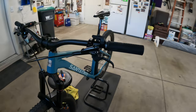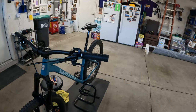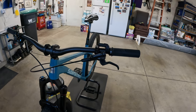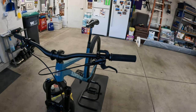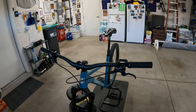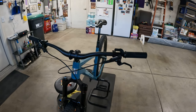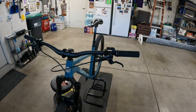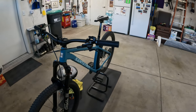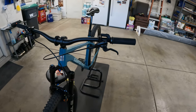I literally couldn't believe it. I had to source a new XT 8100 lever — took a few days to get here. Luckily I have the ability to install it, fill it, bleed it, and get it ready to go. But if you didn't have that ability and needed a local bike shop, you'd be paying more than sourcing it yourself online. I would guess you're probably looking at $150 for an XT lever with labor to install and bleed it. A Deore lever is a little less, but an XTR lever — that is a seriously bad day.